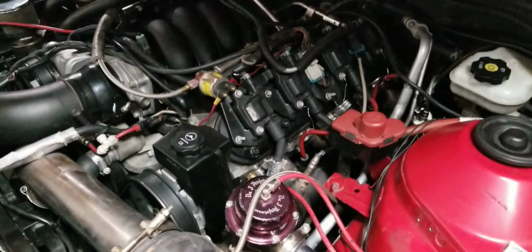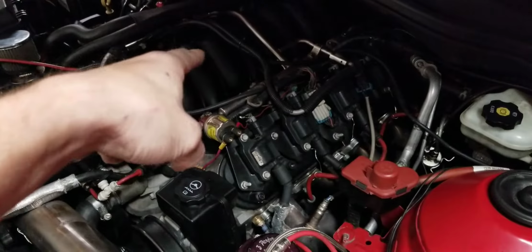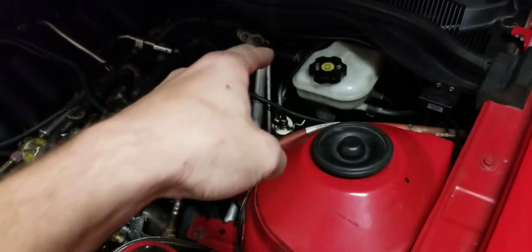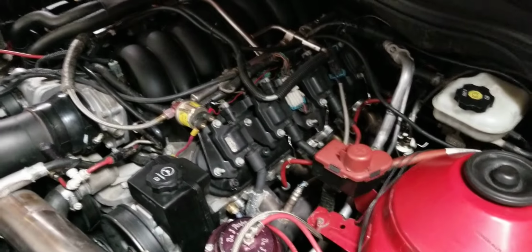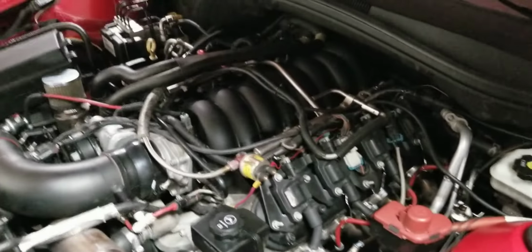I have had issues with just about every sealing surface, whether it's over there on the factory manifold to the crossover, or the V-band there, or this head. Last time I had the kit apart, I took every single one, had them all machined flat, and haven't had any major issues since.